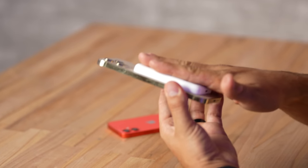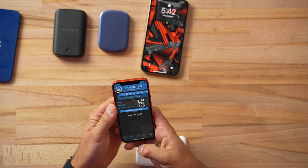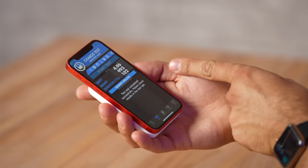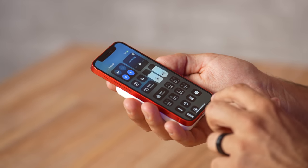I don't know what's going on — we just saw 4.18 watts with the iPhone 12. I can feel a good amount of heat on the back of the MagSafe battery pack, more so than before, so maybe it's tapering down. Taking it off and letting it sit, then testing on the iPhone 12 mini — 4.96 watts. That's still not 15 or 12.5 like MagSafe should be, but we are getting the full 5 watts Apple advertises. Maybe it cooled down. That actually means they're feeding more than 5 — probably at least 6 or 6.5 to achieve 5 watts delivered. This phone was also at about 68 percent battery, so there may be some tapering as well.